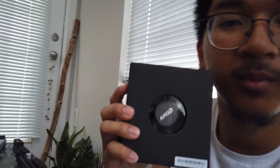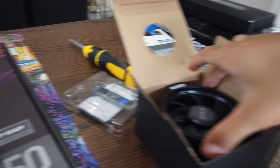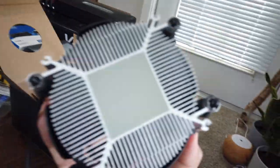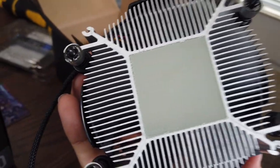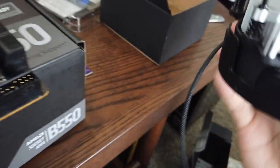While we're here, let me put on the CPU cooler fan that AMD thankfully includes, so I can save money for other parts. Let me flip it for you guys. It has a whole square of thermal paste pre-applied, so let's not touch that. I also didn't buy any thermal paste so I'm relying on this.